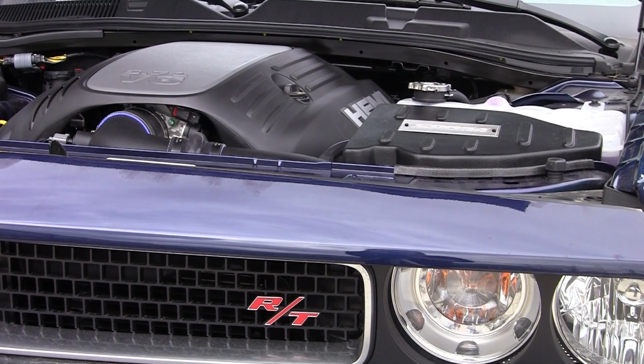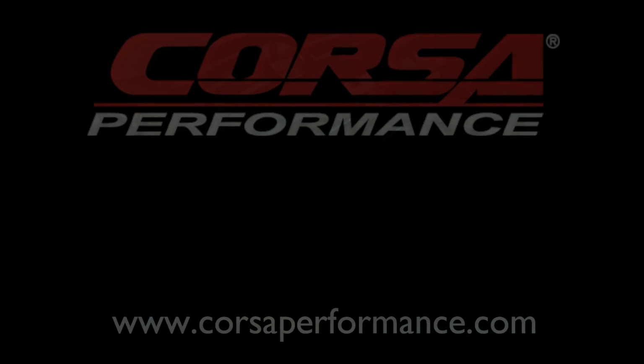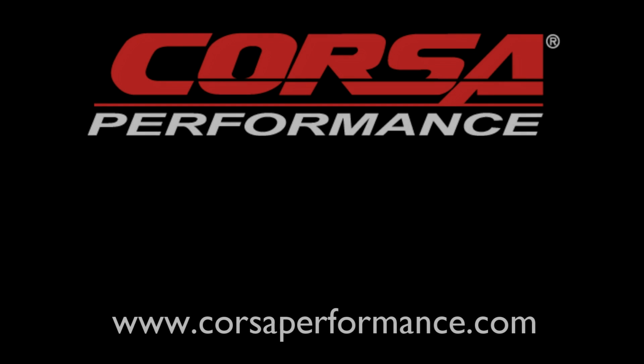Before road testing, start the engine, leaving the transmission in park and securing the parking brake. Make sure to look and listen for any unusual noises or air leaks. Repair problems if needed. Once completed, it will be necessary to check periodically after a few heat cycles for a realignment and tightening of all connections.